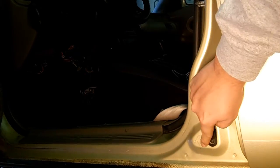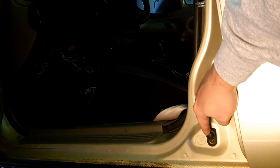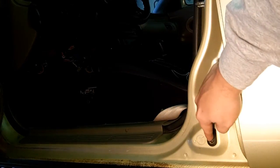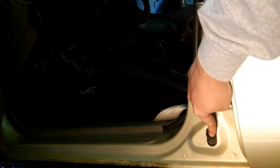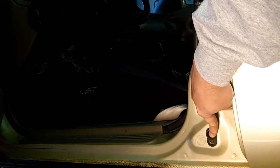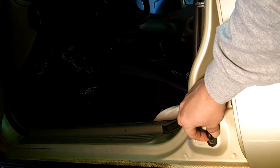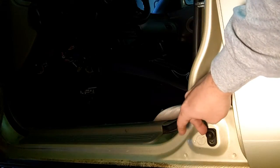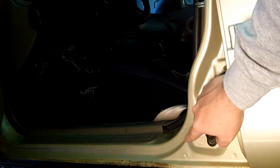As you can see when it's depressed, it's not turning off the light. Now that could either mean that this door switch is stuck closed — if you press it, it's a plunger, but there's a possibility it would get stuck closed. There's also a possibility that the switch inside is broken, so we need to run a continuity test on that. I recommend starting with the driver's side door first because that's the door that gets the most use.